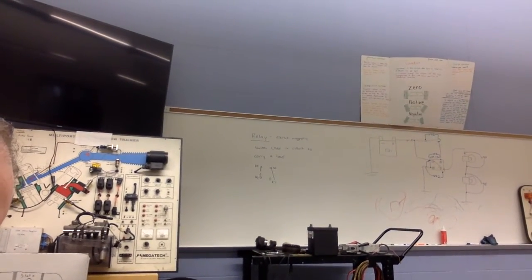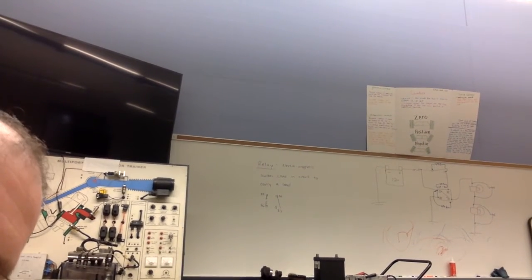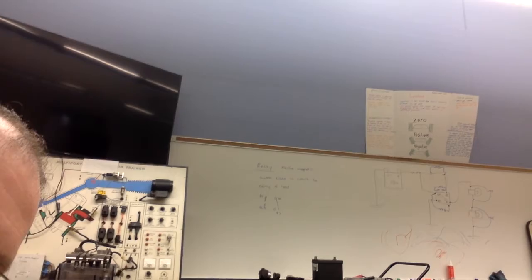And the goal is to understand, number one, what's good and what's not good in regards to voltage drop. So some of these numbers, and I'm going to demonstrate in this video, some of these voltage drops, I should say, should be showing voltage drop where we're using or losing voltage, and some of them should not. So, for example, the first one that we're going to look at is going across the switch. The switch is not a resistor, so the switch should not be using or losing any voltage.